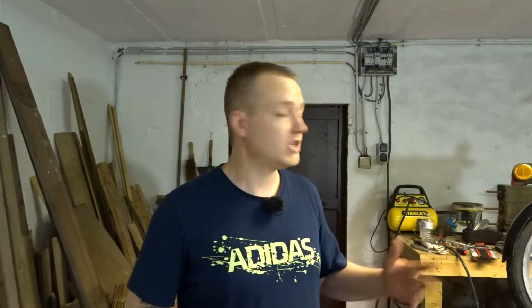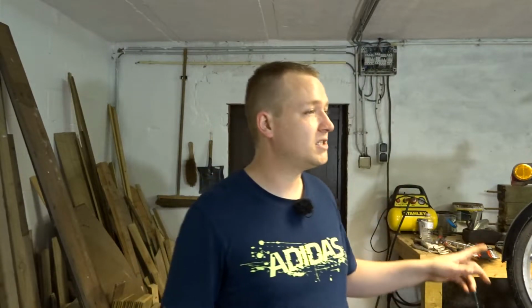Now we're at the point that we can start the bike again, see how it runs with the 64 jet. It's not gonna run perfect, I know that. I still need to tune it, but this is the smallest jet that I have. It will sputter because the previous jet that was in there was a 66 and we still had sputtering. So it's not gonna be the right mixture of air and fuel, but it's gonna be better than the 70 because the 70 blows out a lot of smoke. I wanna minimize that when I start the bike and go for test rides.